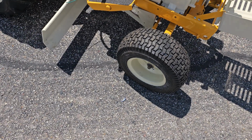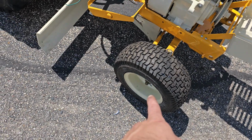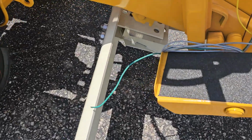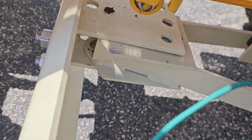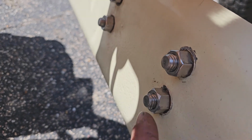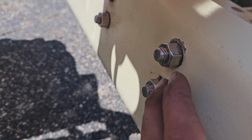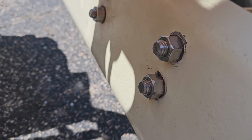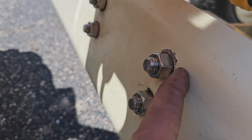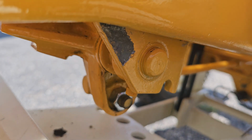I am gonna go ahead and get some case wheel caps for here. I've got to get 3 stainless steel 3/4 machine washers for over here yet. I do have to put the pins and the grader blade for the blade here. I also want to put stainless steel in here, which I did, but the lock nuts that were on here were so rusted I couldn't get them, so I got them off, but it scuffed it a little bit. So I think I'm going to get some stainless steel flat washers, take these bolts off, touch this up in here, and put new flat washers. I do have a little bit of touch-up right there.